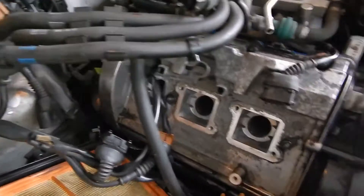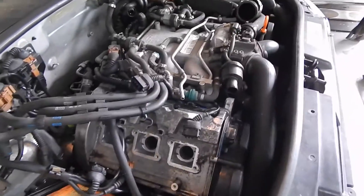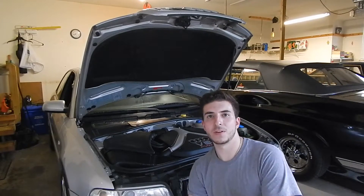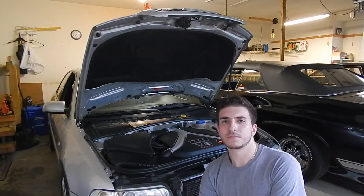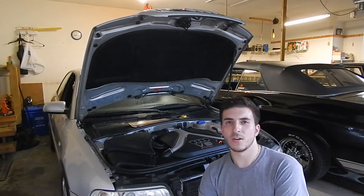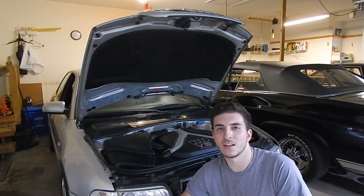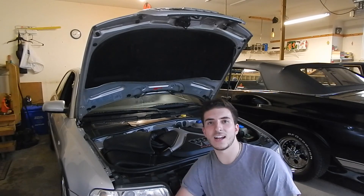All right guys, we're all torqued down now. I always get a little nervous when I do gaskets just in case anything didn't seat correctly, but I think I should be good — everything's torqued down properly. Now we'll just do everything in reverse order to put the car back together. We are finally done with the B5 S4's valve cover gaskets. I'm gonna wait about a day for the silicone compound to dry — that's just recommended. If you guys have the right tools and some mechanical knowledge, not a ton, you should be able to do this. The hardest part is working in tight spots and making sure you don't drop anything. If you like automotive content, make sure to subscribe and check out my other videos.